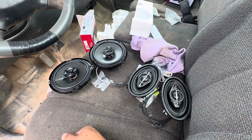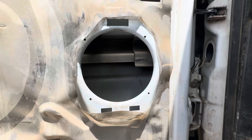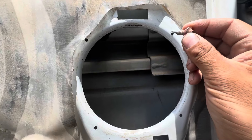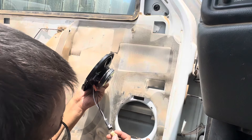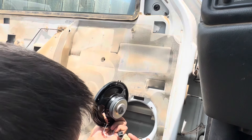Just got back — picked up some Pioneer speakers, front and rear. They were the cheapest good ones that were on sale. This may pain some people how I'm going to put them in, but I've never had good luck with the adapter because the speaker sticks out too far and hits the grill. What I do is take self-tapping sheet metal screws — I drill pilot holes because if you don't they'll walk and go through your speaker — then I put the speaker up there. Easy install.